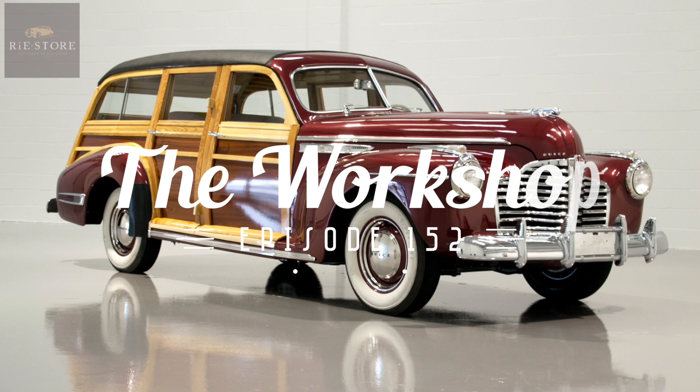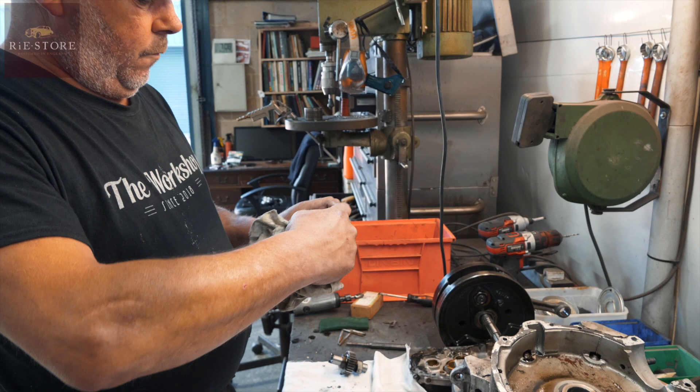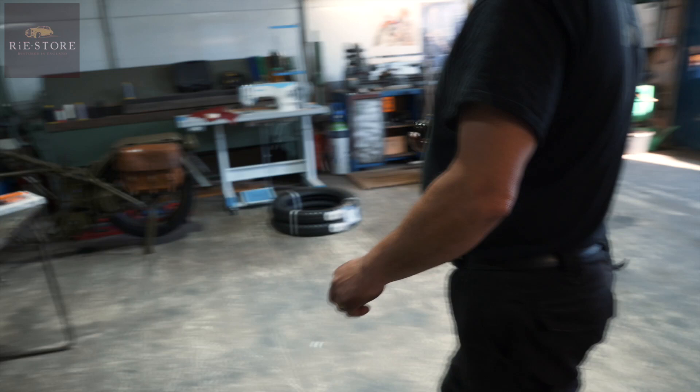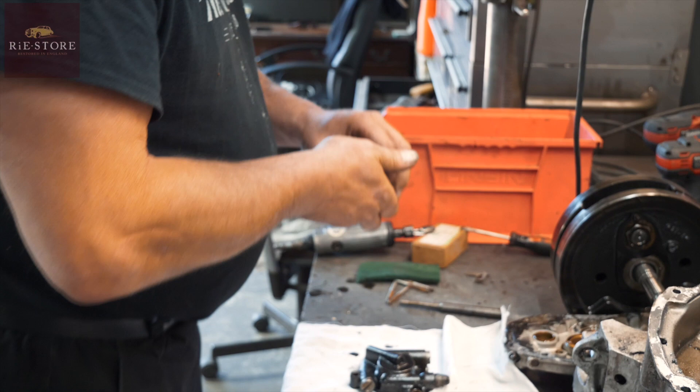So that's your main feed pump — your oil comes from the tank into there. That is your rear camshaft on the rear cylinder; comes out the casing, as we can see on this one. So that's obviously turning all the time the engine is running, and that fits in there and turns your oil pump. So that's the basics of how it's fed and how it's driven.